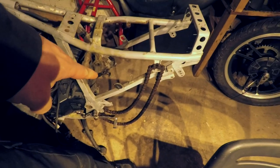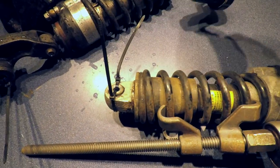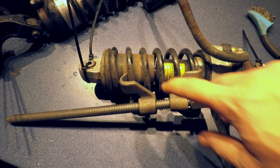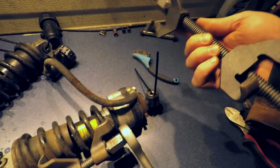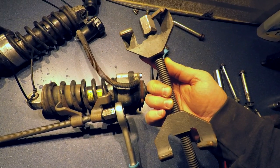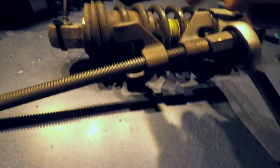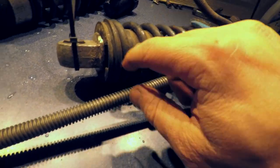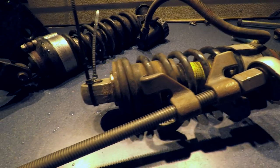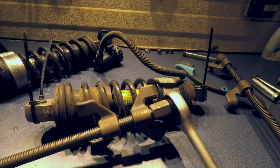That arm is off, being washed. Now this shock absorber - I went online and people actually refurbish these: you change the seals, the oil, and all that. In order to release the spring and take out the shock, you need to compress the spring. The tool I have I used on my Honda when I replaced the front shock absorbers. I'll put one compressor on this side, one on the other side, compress the spring, take this out.